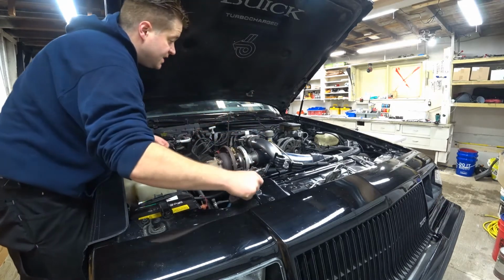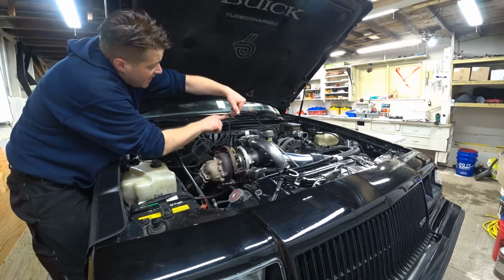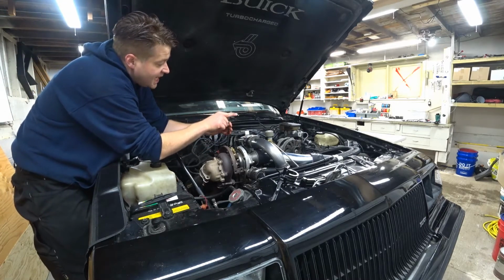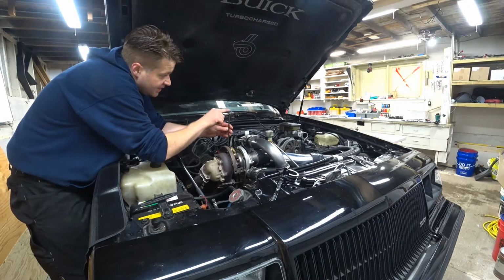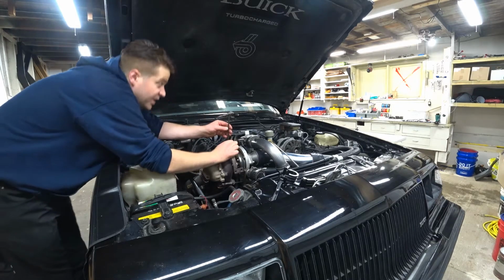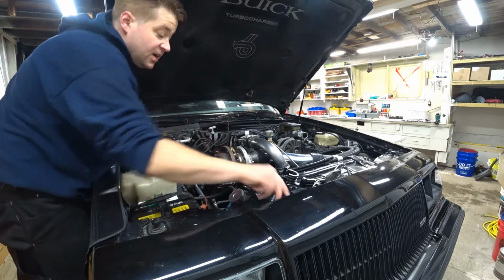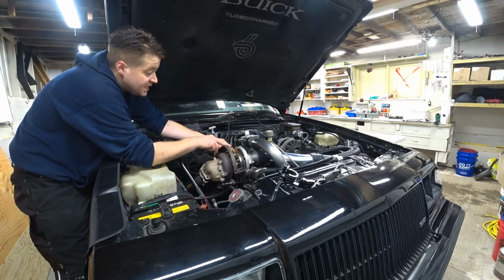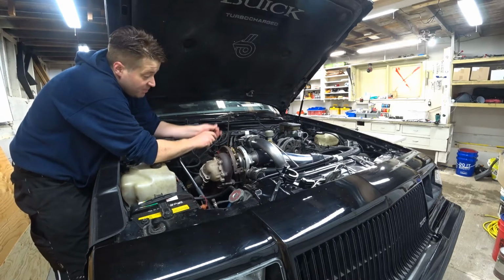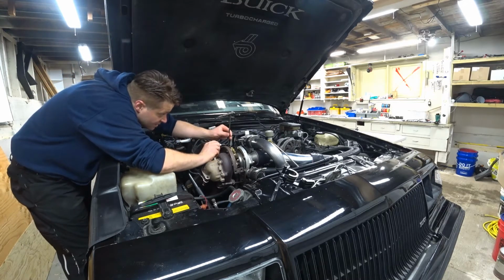So we can see that when we make a mark and make a bend, the resulting leg of the tube will actually end up higher than the mark. So I made a mark right here, and the actual tube ended up about 3/4 or 7/8 of an inch higher than where the mark is. So now I know that I want my leg of my tube to line up right here with this brass fitting. I need to make my mark 3/4 or 7/8 of an inch lower than that fitting.